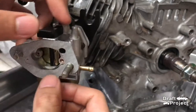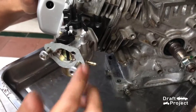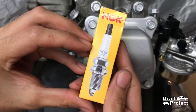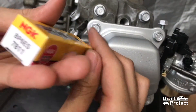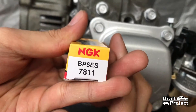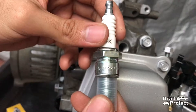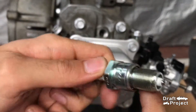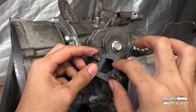Install another gasket and reinstall the nut. This will be completed once installed into the chassis. This is the spark plug for the GX160 engine — it is an NGK BP6ES. I will put some oil into the threads before I install it, and I just use an adjustable wrench for tightening the spark plug.